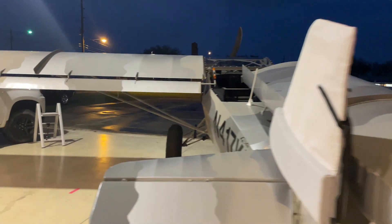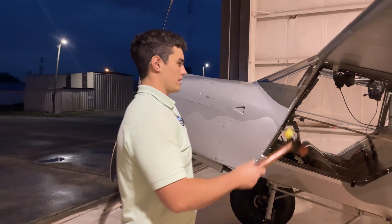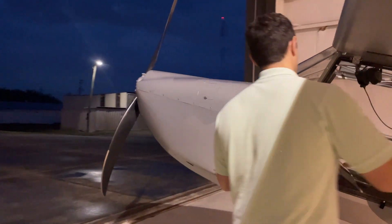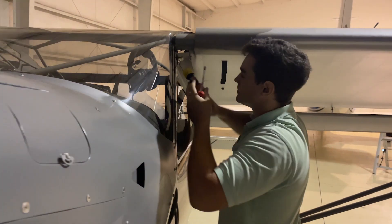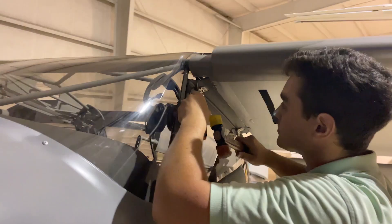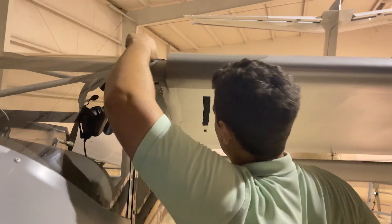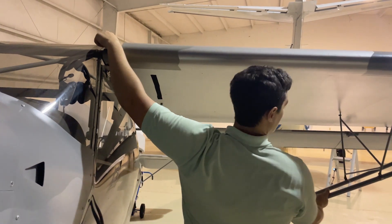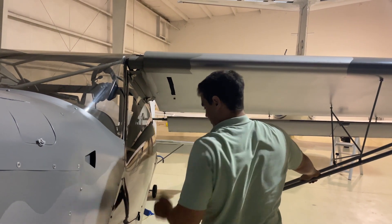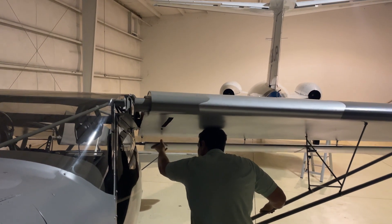Now it's time to do the other side. The second wing is exactly the same as the first — just double-check the flaperons are attached, the pin is ready to go, and the tank is drained. It's hard to get in here because of the bubble door. Everything's clear — looks like we're going to make it back there. I'll hold the weight of the wing, pull this pin, put the pin in the seat, and of course you have to fold this up but not too early.